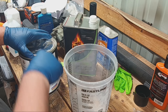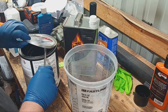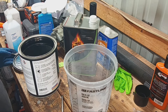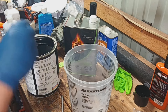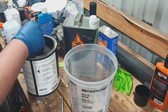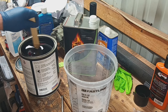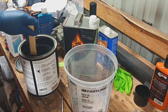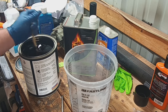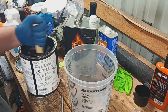Probably not going to be able to film a lot of the painting. I'll try, but I don't really want my phone sitting that close to all the overspray. I'll put it up on a tripod and back away from it a little bit. Stir this up good and I'll put the reducer in. Mix this down one-to-one — got to thin it down so we can spray it. Because this paint right here, it's all thick and nasty.